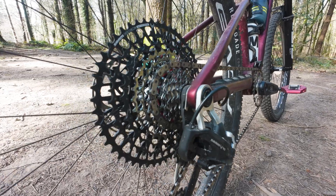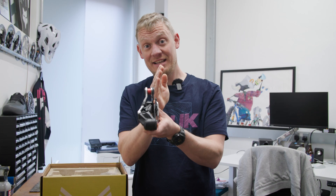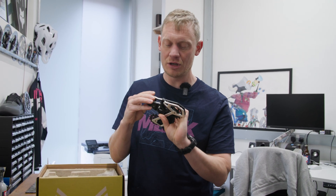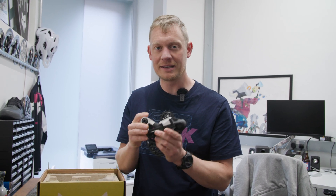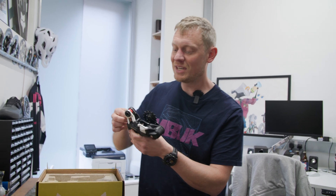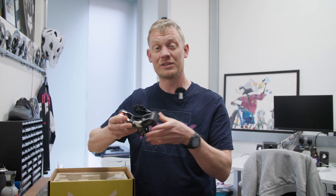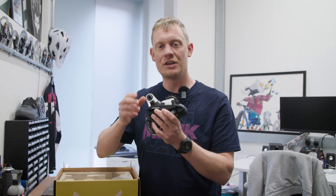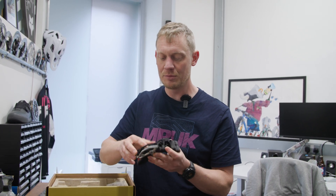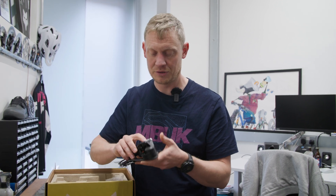This is a very heavily defined placement of the dropout and the cassette, and what this means is that there are actually no adjustment screws on there. This would be the first mechanical groupset with no B tension and no high and low adjust, which should in theory make it quite easy to set up. SRAM says it has a very similar setup process to the electronic transmission drivetrains. The only additional step is feeding a cable through and getting the cable tension right.